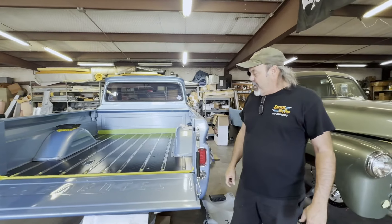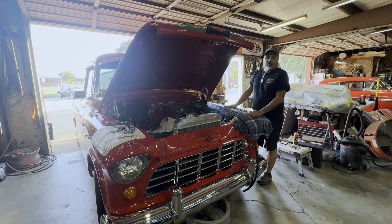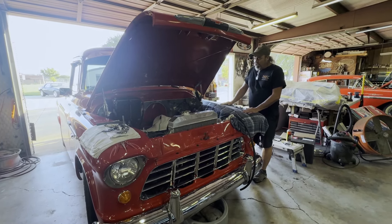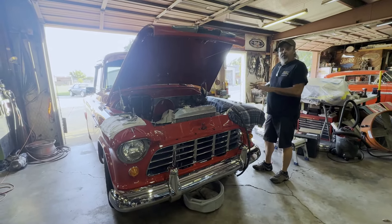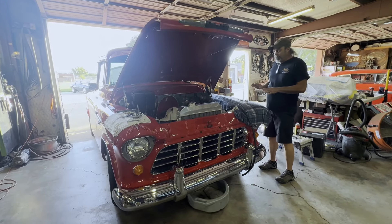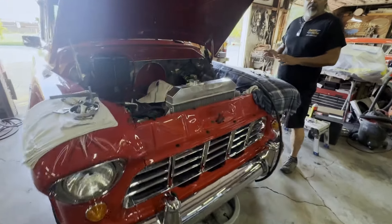The wood kit came from Markay — it was pre-cut and pre-stained, though we did have to cut it for the fillers. We have a local customer whose truck has been with us before — it was in about 10 years ago for an interior. The truck was in storage for quite a while and had some varmints chew on some of the wiring. We got that addressed, but they weren't happy with the brakes — this cam's a little spicy, it only makes about six inches of vacuum and they had a vacuum booster brake on it.